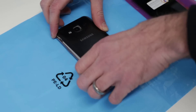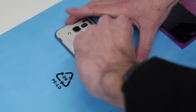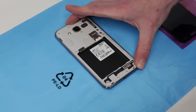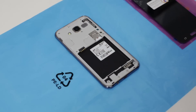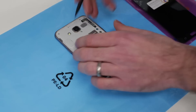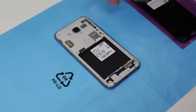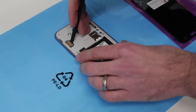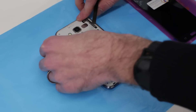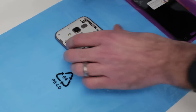First of all what I'm going to do is remove the back cover and the battery to make sure the phone is completely off. Then I'm going to grab my little pry tool and use the tip to pop off this little cover. This is the display connector — this is what the display and touch panel are connected to the phone via.